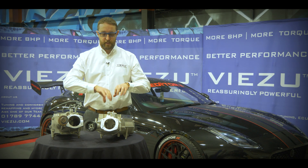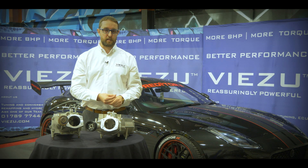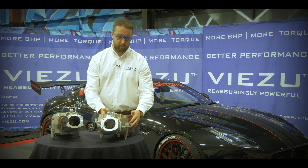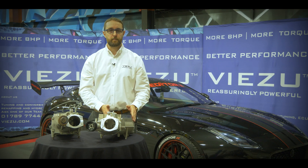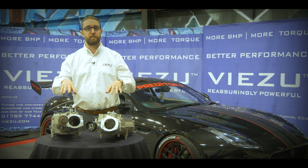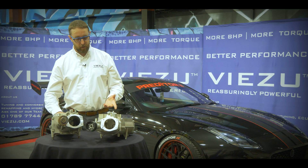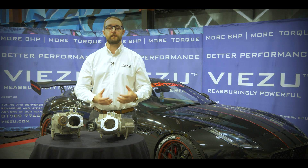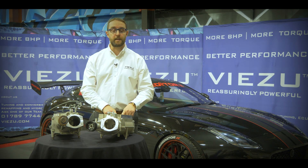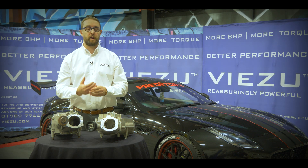What this allows them to do is get rid of any restrictions on the standard Eaton charger, and flow the air the way they want for the gear set that's fitted. You'll see subtle differences in the design — it sits a little bit wider, with fins down the side to allow for the bigger gear set. At the back, the bearings sit a little further back as well. Looking inside from the top, the aperture — the opening for airflow — is much bigger, increased by about 20% to 25% over the standard one. It's been opened and machined while still maintaining the required strength, allowing extra flow and giving a clear view of the 2300 gear set inside.